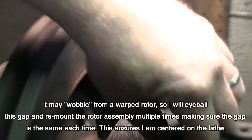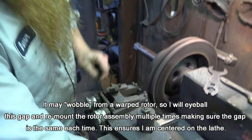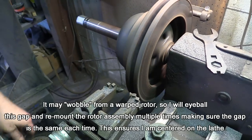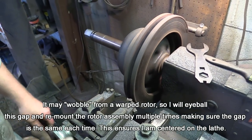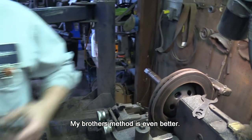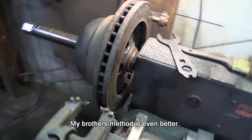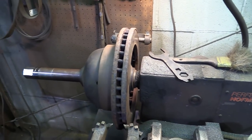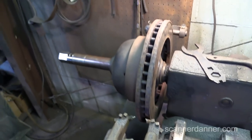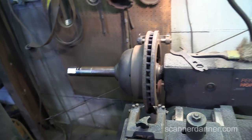Like, a lot of times if you have a thing like that, you can make a mark with the one, you know what I mean? Then reset it up and make sure that mark's in pretty close to the same spot. And wouldn't you say, you're not dealing with students like I am, but the biggest thing that we see in cutting a rotor is that part right there. You don't chuck it, you don't set it up on the machine right, that's where your issues come in.